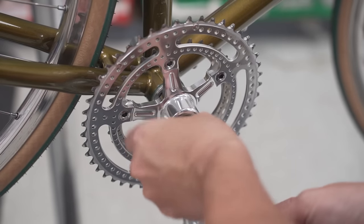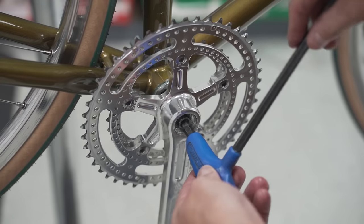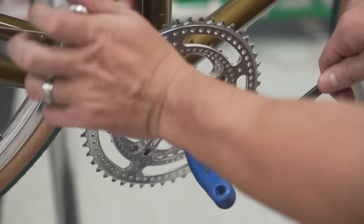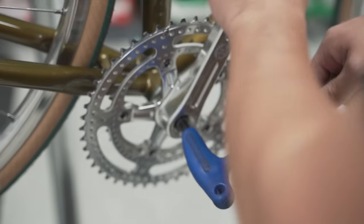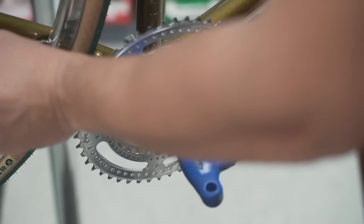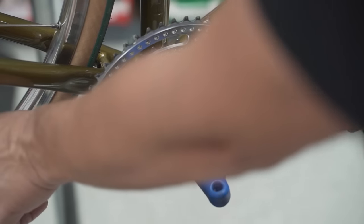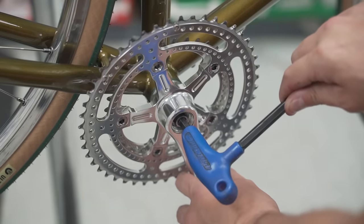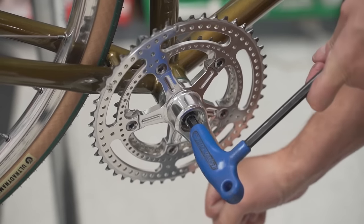Now, bottom bracket spindle lengths are determined by the crank. So with our Drillium and our 50.4, the crank set asks for a 118 millimeter bottom bracket. Other ones might use 103, or maybe 110. Like our single ring crank set uses a 110 for proper chain line. The mountain crank sets use different spindle lengths. So when in doubt, ask the manufacturer.